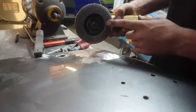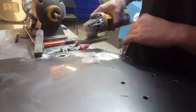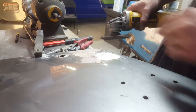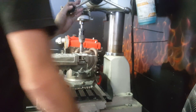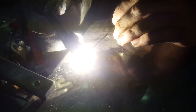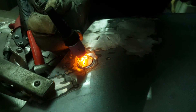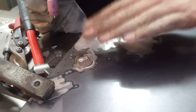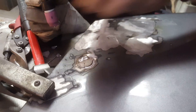As I always say when it comes to the flap disc — let the flap disc do all the work, not your muscles. If you heat the crap out of this, the friction from the flap disc could make it warp again, so go nice and easy until it's flush and smooth. Remember, body filler will take care of the rest. Now of course it's going to warp, so we're going to let it cool down a little before attacking the other side. Let it unwarp itself — if it pulls up, it'll pull back down once it cools.